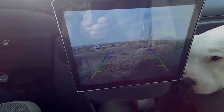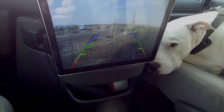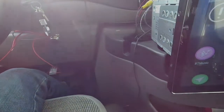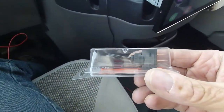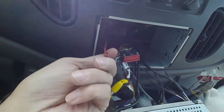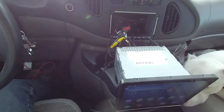I've got to do a little aiming — it looks like it needs to point downward a little bit more so I can see the top of the motorcycle. But it's definitely working. Now I'm gonna cob in this one switch I have — I'll put terminals on these wires so I can change it out to a different switch once I pick a better one up. I wired it in right here this morning, soldered the connection, and heat shrinked it. Once it's all back in the dash I'll give you a final update.